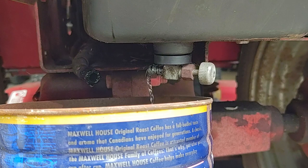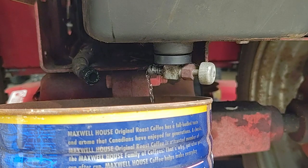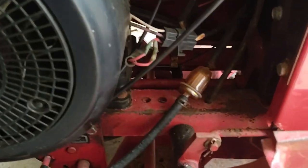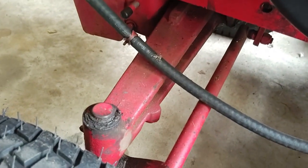I'm going to take an air hose and blow through this end of the fuel line through the front. It's not bad fuel back here, but I'm concerned about the fuel line and what's inside of it. While that's draining, I'm going to place that fuel line right there. There's a spider — I don't like spiders.